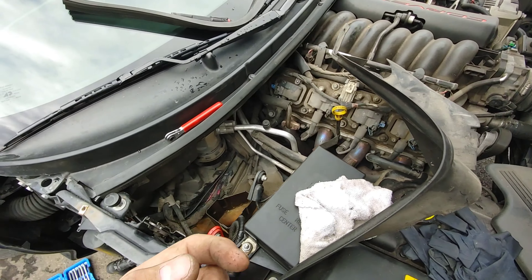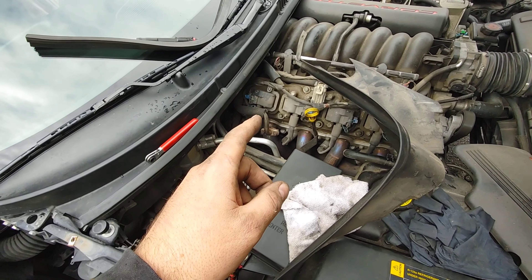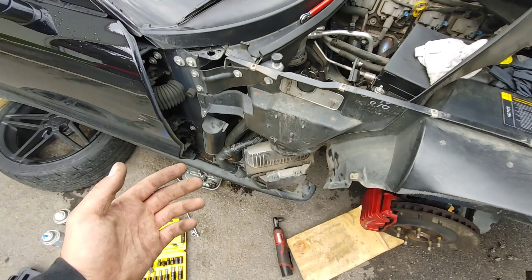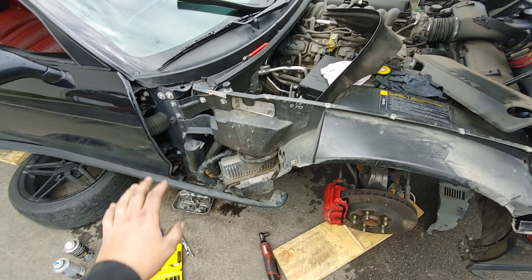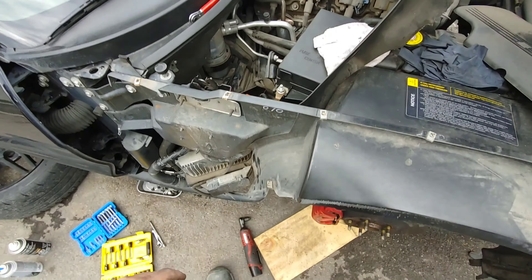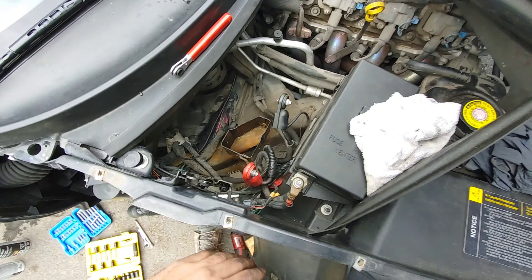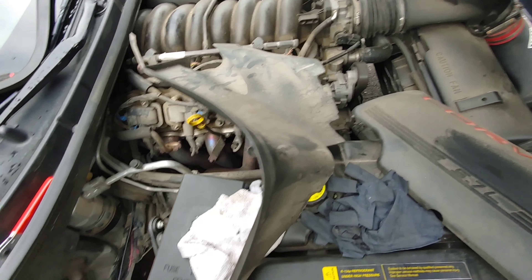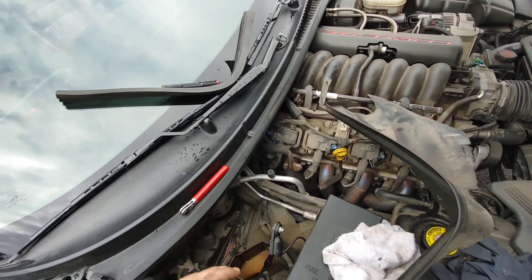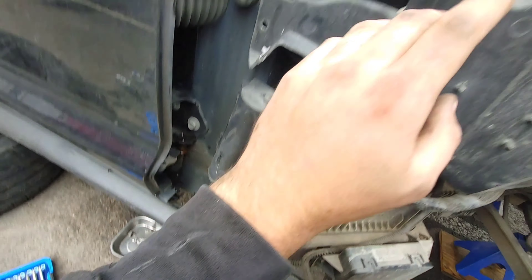I really didn't suspect that the pipe was unplugged at the back of the intake. You might say you wouldn't have to remove the entire fender just to access the back of the intake — but in my case it gave me the chance to get much closer and not scratch the fender. I was finally able to replug the vacuum line into the intake manifold. If you have a leak on this reservoir, you may hear a kind of sucking noise because these lines suck air.